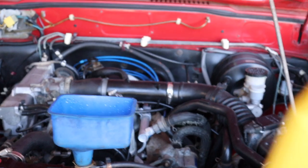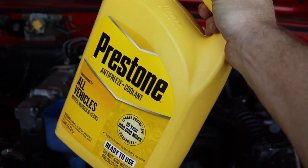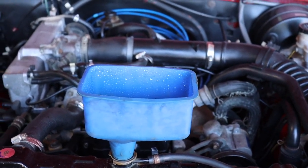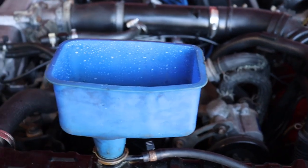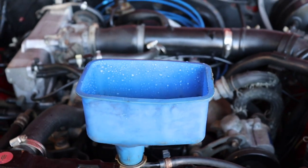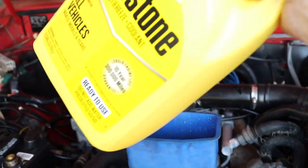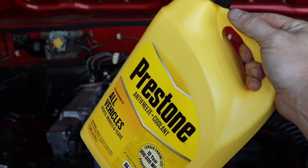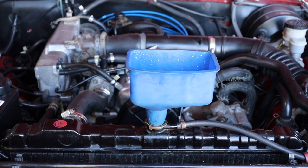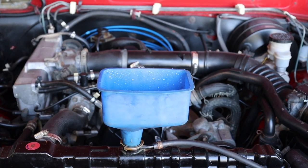With everything drained out of the system, it is finally time to add our 50-50 mixture of coolant — your coolant of choice. Go ahead and top the system off and burp it, keeping the funnel in there as the truck comes up to temperature. Bubbles will come out — we go until there are no more bubbles, do a couple heat cycles, and we're good. With that system burped and full of actual 50-50 coolant, we have cleaned up our cooling system in the Isuzu Trooper. Take care, and we'll catch you on the next one.